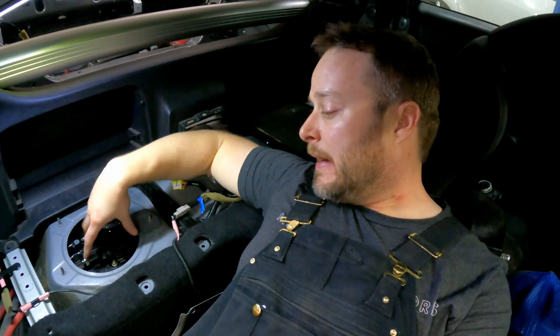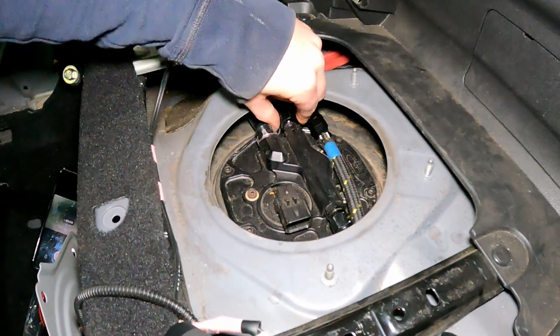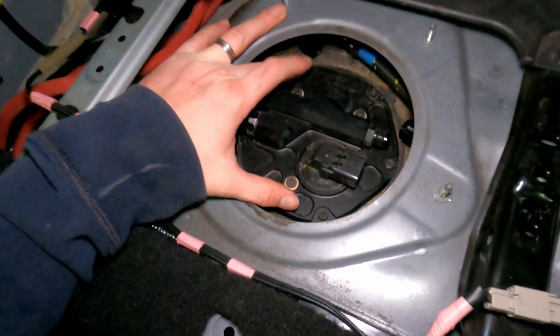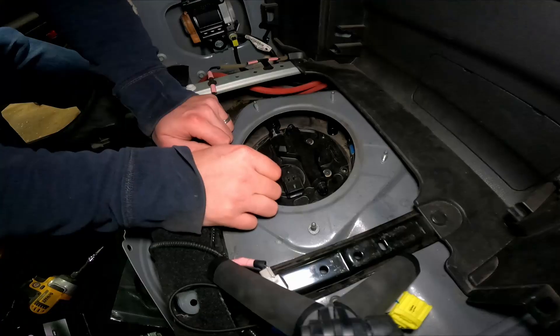Put the hanger on inside the tank. I extended mine — you don't have to do that, but it made life easier for me because I was fighting with it. The wiring is pretty short for the hanger. If you extend it, you can lay the twin pump assembly off to the side while you put the hanger on the inside.